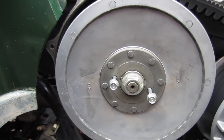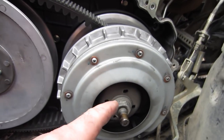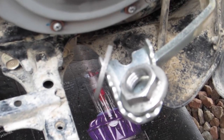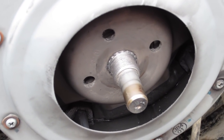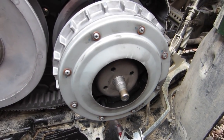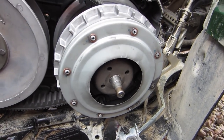Now use two of the bolts — screw them in place on the secondary clutch — it'll spread the sheaves open, then it makes your belt loose. Once we take off the big 22 millimeter nut to get the belt off. I got the nut off. Some people don't recommend it, but I use my little 18-volt impact gun. If you're going to use a regular ratchet, you'd have to have some way of holding your clutch, or you can take a nylon tie strap and wrap it around there, hook it to your foot peg and tighten it up — that'll hold it. That's what I'm gonna have to do when I put it back on and torque it.